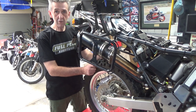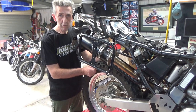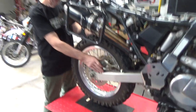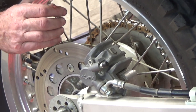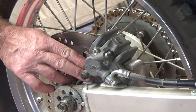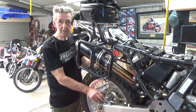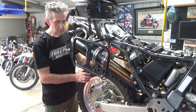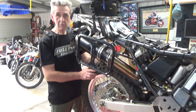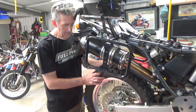We're a little bit different here — we've got the time to put a little bit more TLC on doing the job. Also, the caliper has got a pivot, so the caliper can move off and on the rotor. After Boris has done 15,000 Ks, I prefer to lube and check that pivot and make sure that the caliper is free to move in and out. So, do that properly and remove the wheel — we're going to remove the wheel.